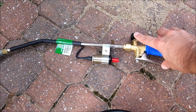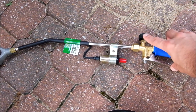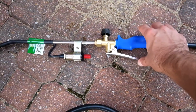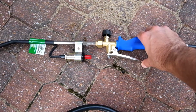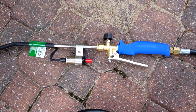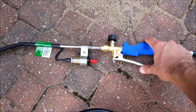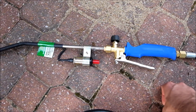There's a valve to adjust your pilot light. You can also use this as the burning feature. You just turn it up and you'll have a pretty solid flame. I have a fully charged tank, and when I have that tank fully open and I press this, it blows itself out. There's too much. What I did was just control the valve on the tank to where when I have this holding down, the flame is just where I want it.